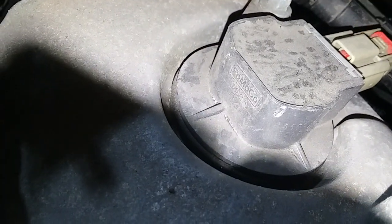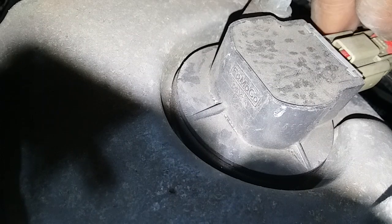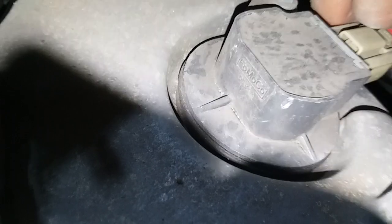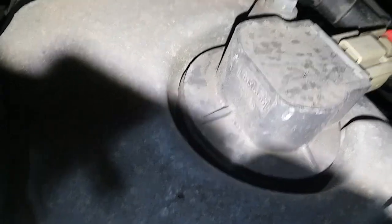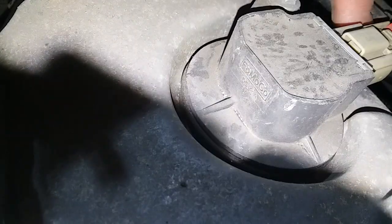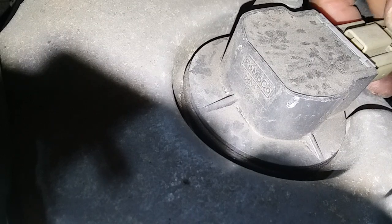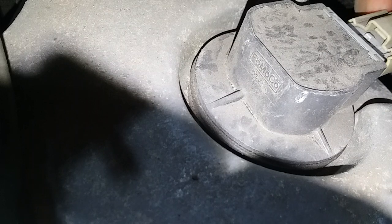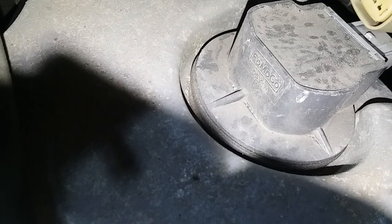Pull the red tab back — this is the fuel and coil-on-plug harness. Pull that back and then you can push in the middle of this tab here. If you squeeze it down and pull, it'll come out. I'm gonna release the three on the front here and get working from there.